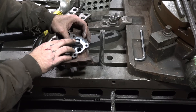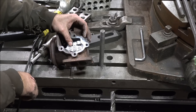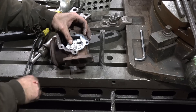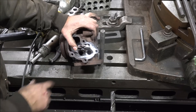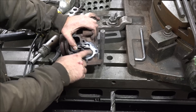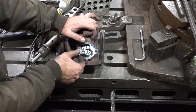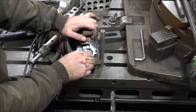That'll make this thing easier to control, keep the boost down, and hopefully I'll be able to get a nice drive pressure to boost ratio. By going from 7/16-inch ports to 5/8-inch ports, I've doubled the cross-sectional area flow-wise, so this might theoretically be able to flow twice as much — as long as these valves will get out of the way enough to let the air through.